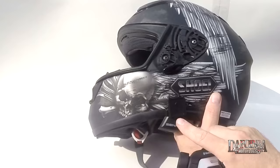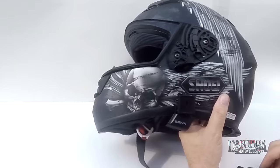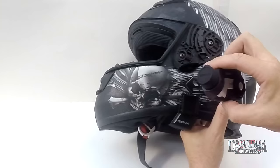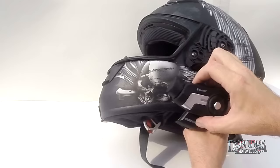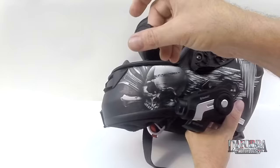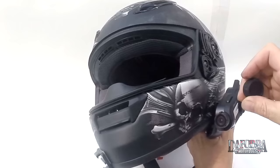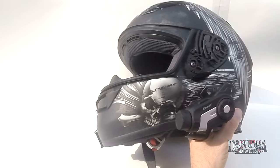Now is a good time to test fit the 10C to see how it looks and where it's positioned on your helmet. This arrow should be facing up. If you loosen this little cogwheel, you'll see you can spin this, and that's what gives you some adjustment on the camera - but you don't want it to be too loose, otherwise it won't stay on. So I'm just going to snug it up a little bit, and this just press fits in. I don't believe there's a lock on it at all. There it is - you can see right now I can do my rotations and lock it down, and once it's locked down she's not going to move. The lens cover is still on here, and you can see it allows you to rotate back and forth to get the angle that you might need when it's on the helmet. Pretty cool feature - I actually like that very much, kind of fine-tune your shot.